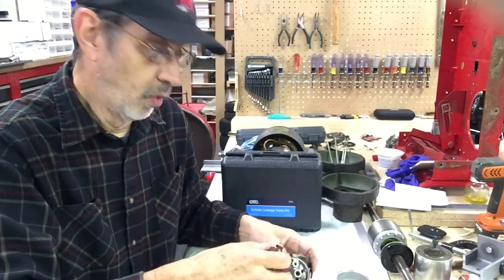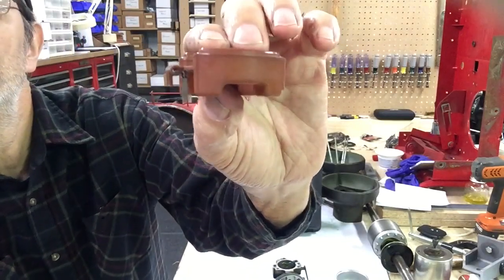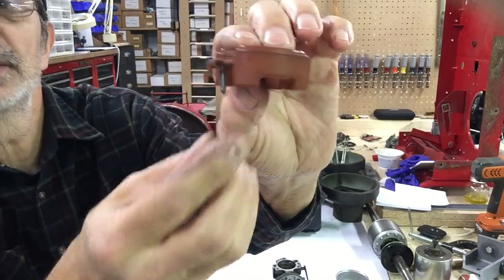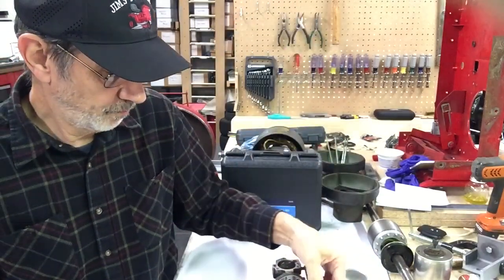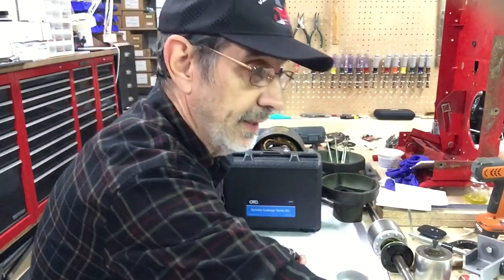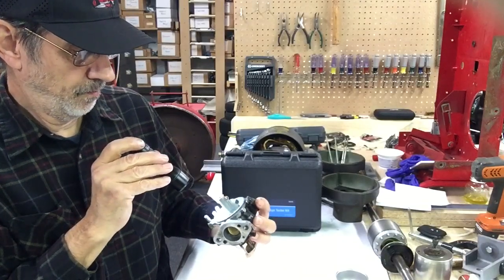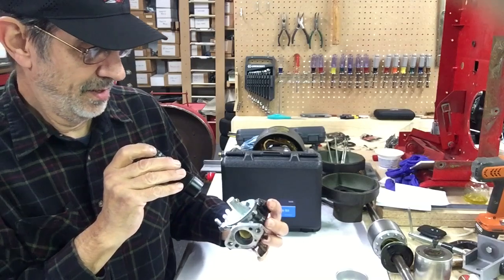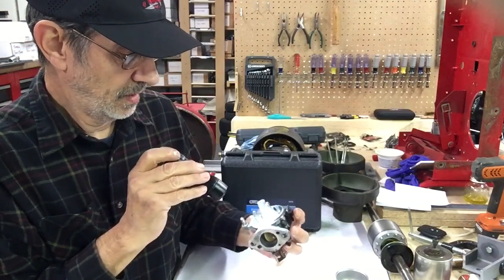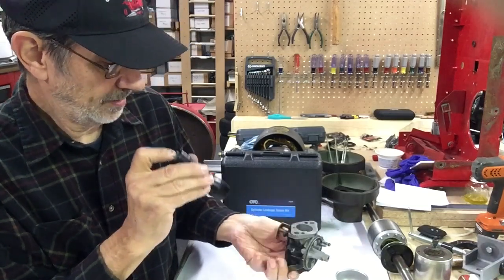And this is old school. This is an old tractor, and it does not have, if it'll stop wiggling, it does not have a rubber tip. It's a solid steel one. And I don't know. There's a lot of crud down in there. That's probably why it's not sealing up. But we're going to throw this in the cleaner and see what happens.